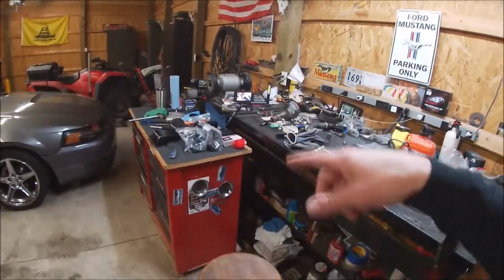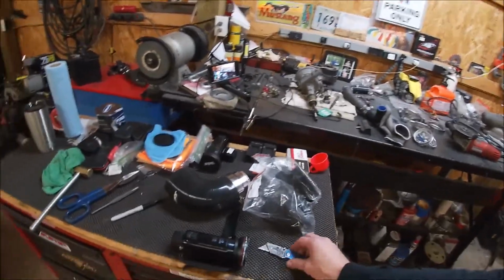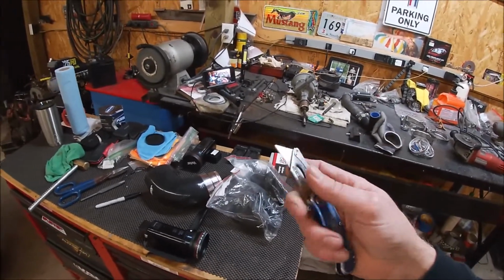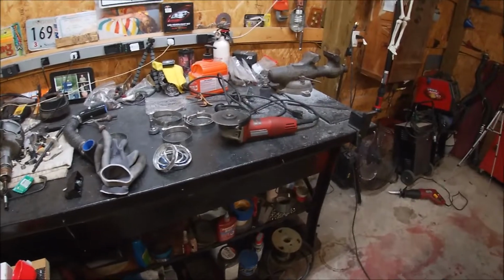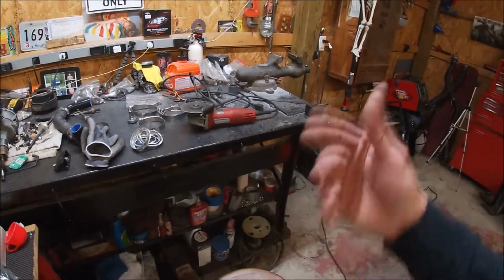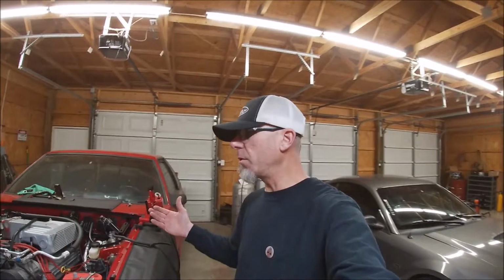And then just take you a bench grinder, deburr around the OD of it, and then take you something like this box cutter. And I just use this right here to deburr the ID of the pipe. And I use the angle grinder with the cutoff wheel and cut it with that. So that is done, guys. That's another one, like I said, we can check off the list. We still got a lot left to do on the Red Demon. I'm gonna throw that cup in over there real quick on that hood hinge.